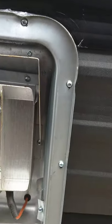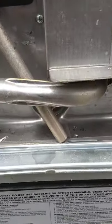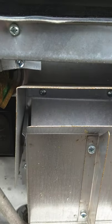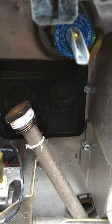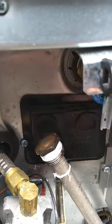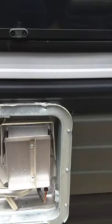The switch to operate this is on the inside of the trailer. Before you take this plug out, always pull up on this and vent the pressure out of it, so the anode rod and plug don't come shooting out like a cannonball followed by a gallon of water. Always let the pressure out before you take the plug out.